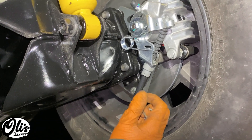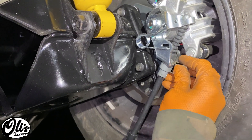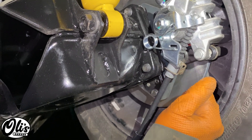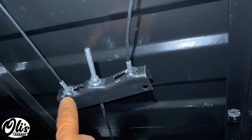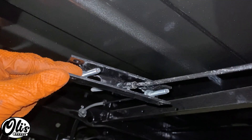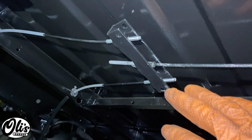The last step is to connect the parking brake cable — just slide it in through this hole, get the little round piece into the lever, grab your parking brake cable clip, and slide it on right here. It basically just holds the parking brake cable from slipping out of that position. I still need to come up with a way to mount the cable up here, but aside from that, the parking brake cable slides through this little grommet and then up here, where it attaches to the divider. I used an M6x1.0 nut here and the same M6x1.0 nuts for the other two as well. With everything tightened down, when I pull tension on it, it holds the brake.